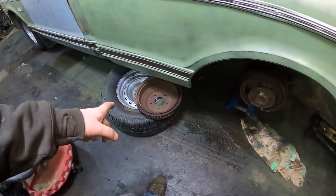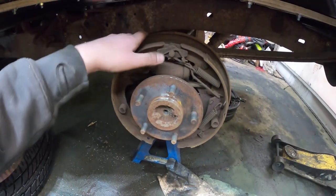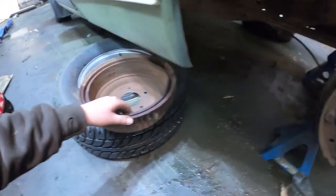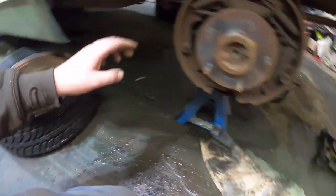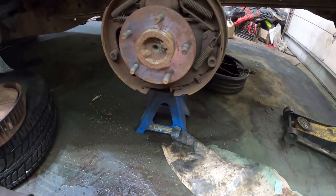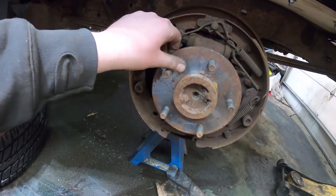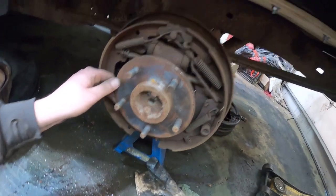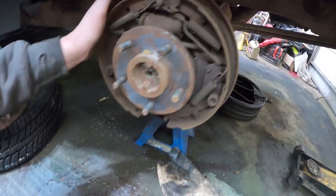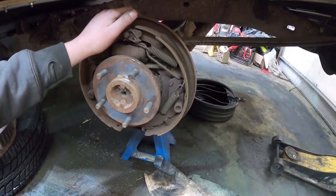Truck's in the air. Pulled the brakes and stuff — actually never even looked at the brakes on this thing, but it looks good. The wheels aren't leaking after doing them. You don't feel a big ridge in the drum so they're probably still decent — not much left on the shoes, but not too bad actually. These axles on both sides, they're shiny, not even rusty. So I don't know, maybe those have been changed at some point or something. I've never seen that — usually it's rusty the whole way around.